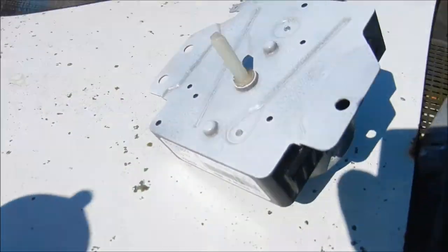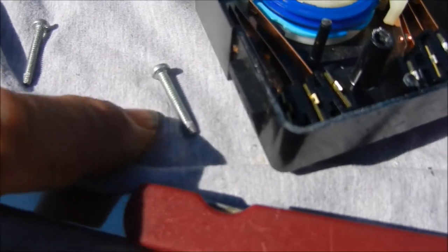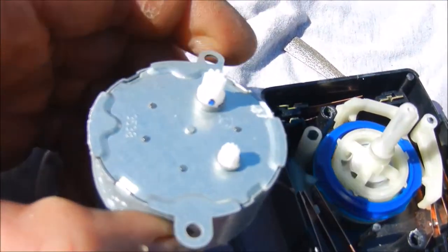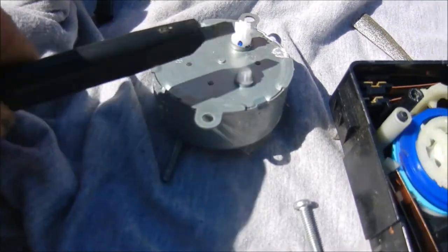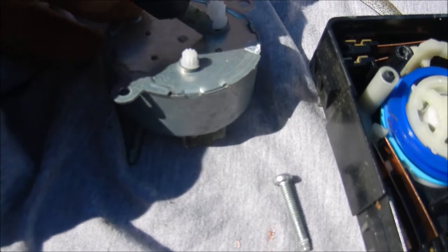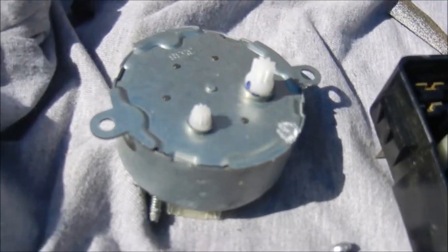You can see typically what happens: there are two screws that basically hold the face plate on. I normally take the face plates off and paint them. Those same screws also hold the motor in place. This gear right here is marked, and what I normally do is mark it again wherever it's at and put 110 volts to it — I've got a jumper wire I put directly to make sure that thing's going to work.